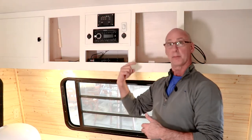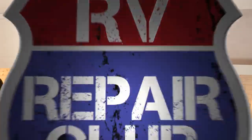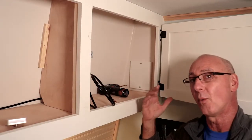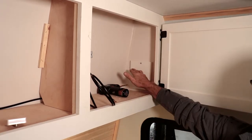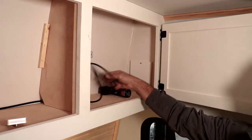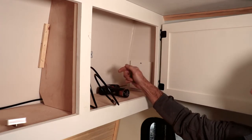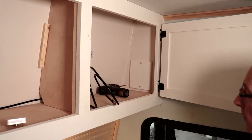Where that leaves me now is I got to run and get a drill and then punch that hole through from inside to outside so we can thread the coax to the outside. It's always really, really difficult, nearly impossible, on the outside of the camper to locate where you are relative to the inside. It's easier to just work from the inside out. This drill bit is not the right size for this coax. Easier to start small, and then I'm going to come back in from the outside with a larger bit, and that gives me way better control over what's going on here.